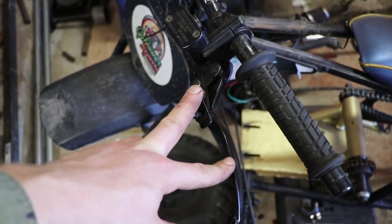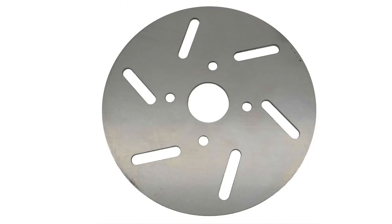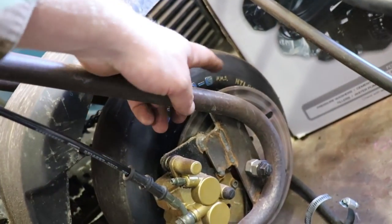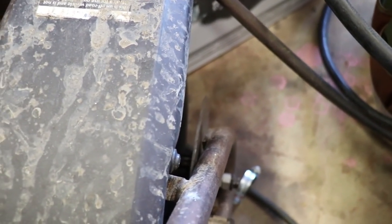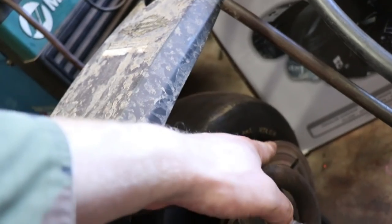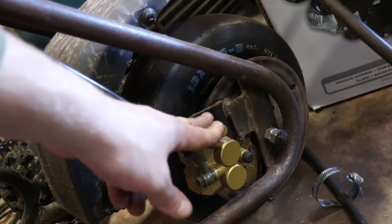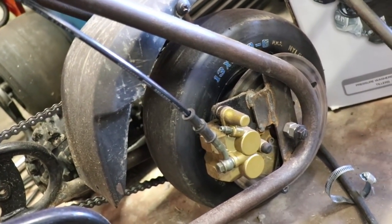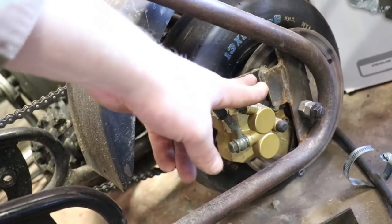As a side note, this is the other minibike that I have - it's the same style of minibike. It has a hydraulic lever and brake line, but it has a different, much more heavy-duty brake caliper back here. I've left a link in the description for that. I actually had to drill the holes in this one to make it fit and space it out with a little nut between the hub and the brake disc itself, but it has extreme stopping ability. I can lock the brake up full speed going 50 or 60 miles an hour down the road.